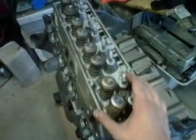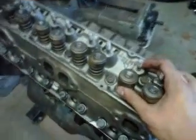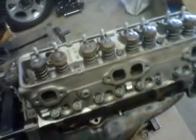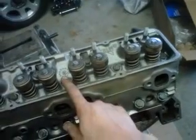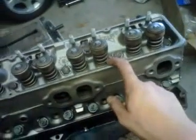I wanted to talk about torquing head bolts really quick, because if you don't do it right it can lead to some pretty serious problems. You always want to go in a three-step process of torquing. On this Chevrolet, the torque spec is 70 foot-pounds, so what I do is go in a three-step process — I'd go to 25, then 50, and then finish it off at 70.